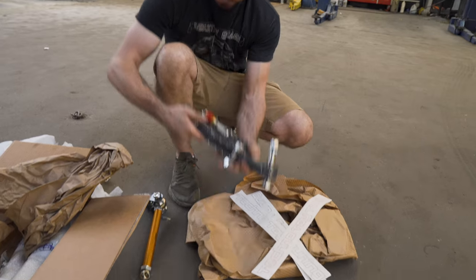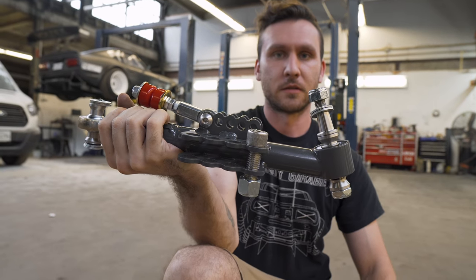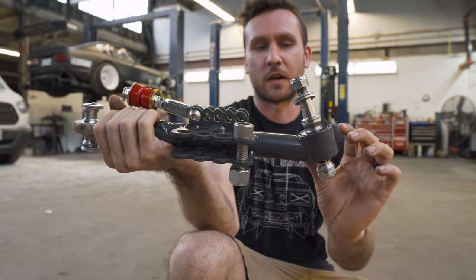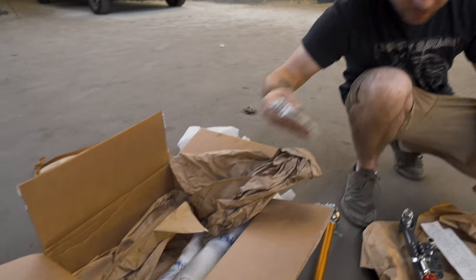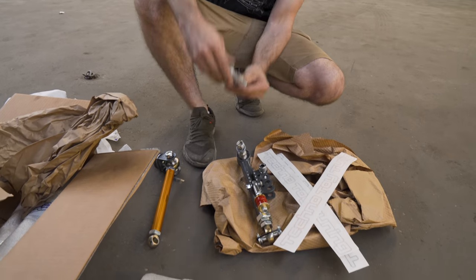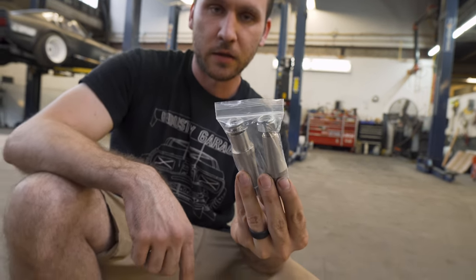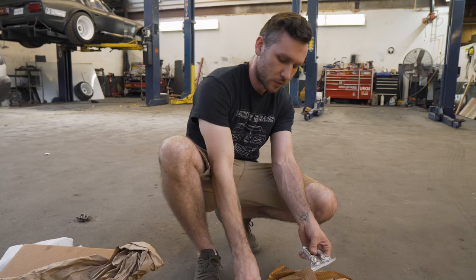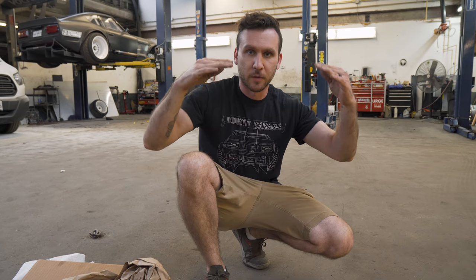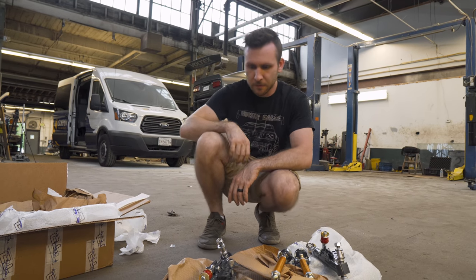The angle of that ball joint is way different. I could actually get the other arms I have that I bought from them a while ago — this angle is pitched like maybe 10 or 15 more degrees that way. It also gave me these ball joint ends, which are S14 ball joint ends, which I might need to use. I did make the S30 ones work on my ball joints last time. I'll explain with the spacers — depending on the height of your control arms, you should space them out so you're not losing travel. So why don't we transfer over to the 240?